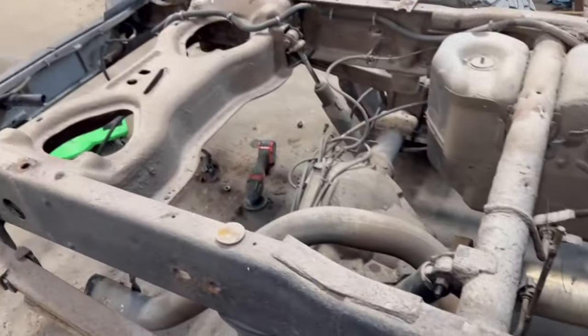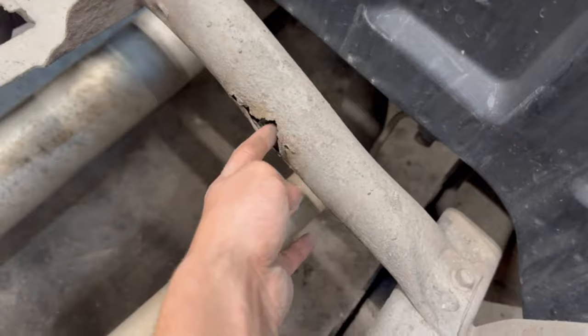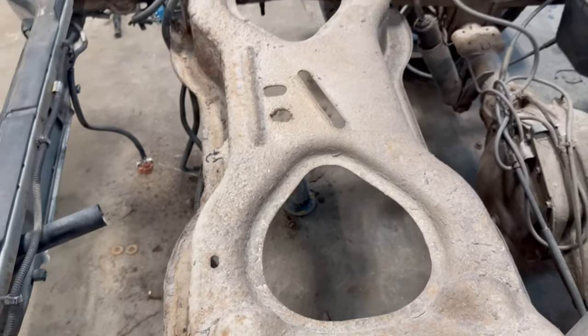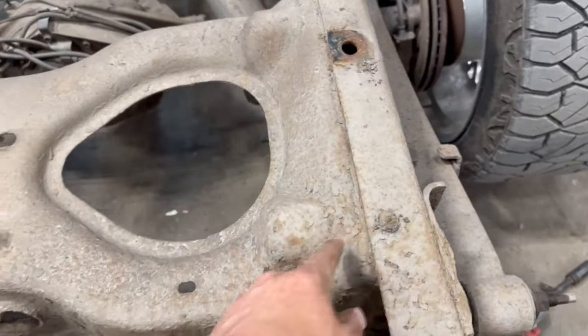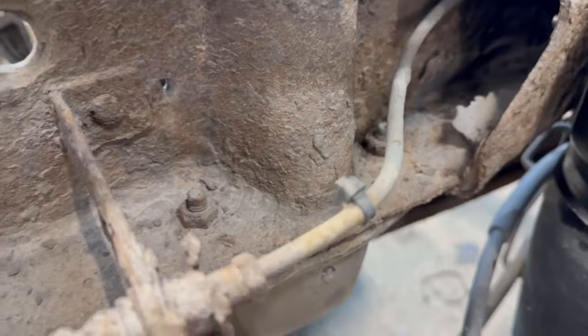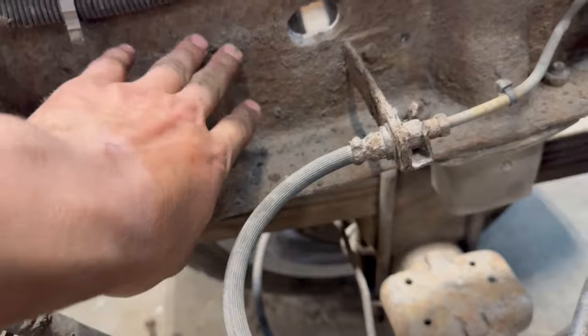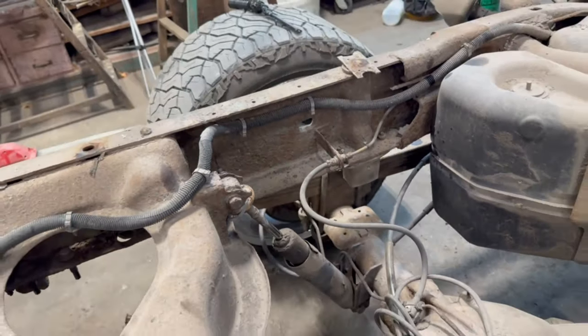Taking a look at the frame here — it's bad. Got really rusty up in there. We got a new cross member — this one's got a hole in it. We got a new spare tire cross member from Hicksville. These are really easy to change out — you just got these rivets. The rest of the frame is a little scaly but isn't too bad. Usually these areas rust out but these are solid, so that's good. We're probably going to cut it right here and replace this plate that goes over the frame because it's bubbling out from rust behind it. That'll be relatively easy to do.